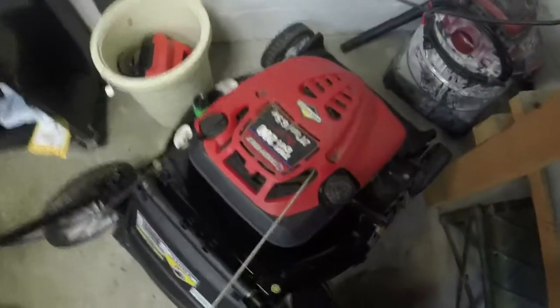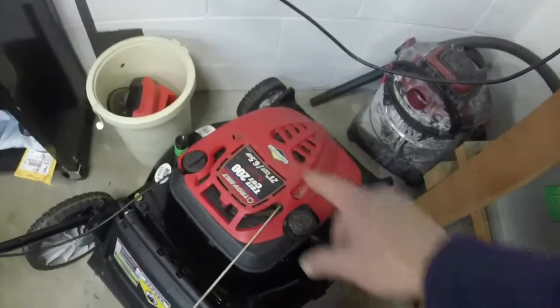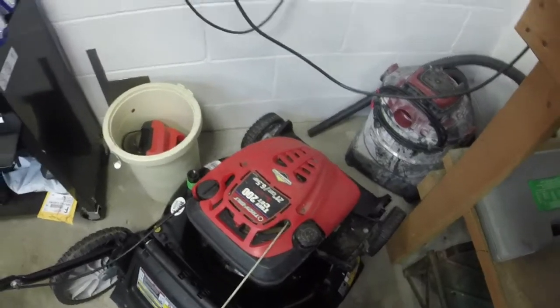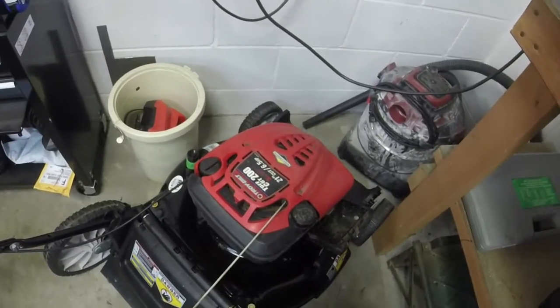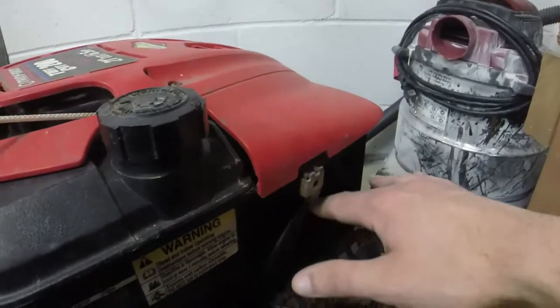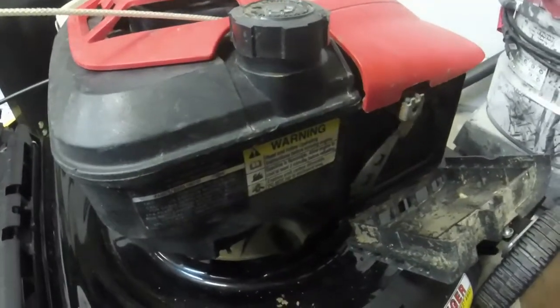You see an occasional flywheel key issue, especially on the 675s, but this is a six-and-a-half horsepower Quantum — it came off a Troy-Bilt and I put it on a Murray deck. The majority of these have around 190cc displacement, getting up to about seven horsepower. They run well and cut good. Sometimes the plastic air filter covers will warp and it won't prime very well — that's really the only weak point, along with the gas tanks, which can crack if left out in the sun. But there's a lot less plastic on these than on the new ones.